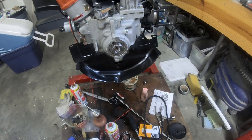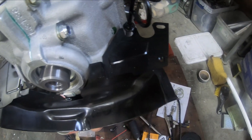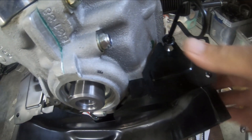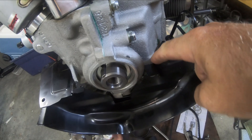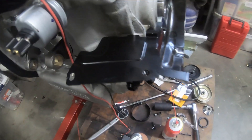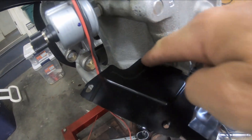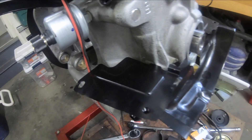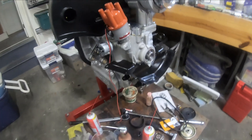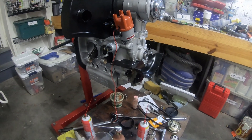Under the pulley I have to put this pulley tin. The pulley tin fits around various things including the dipstick. On one side it looks okay, but the other side definitely needs to be trimmed. I'm going to do a little trimming of that tin — it's just not meant to fit on an aluminum case with this casting.